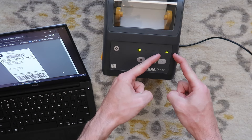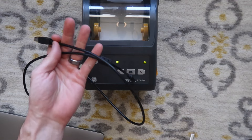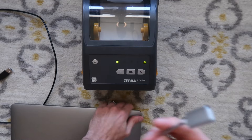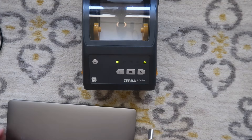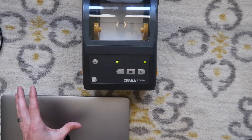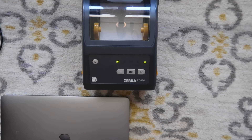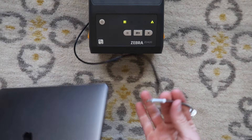Now that it's connected to the network, we're going to set it up with a Mac. If you're going to do it via USB cable, you may need a dongle if you have a newer Mac because we only have USB-C ports — I'll put a link to the dongle in the description. First I'll show you how to set it up via USB, then wirelessly. Note: you cannot set up your network settings with a Mac. The initial network configuration can only be done on Windows or Android. You need the green network light first. Let's go into the computer.